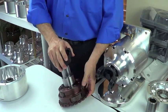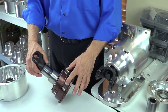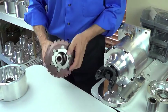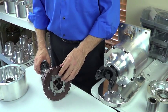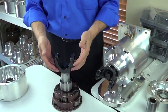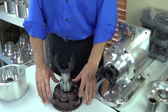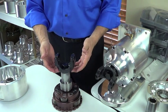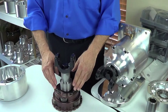The planetary gear set itself is a billet housing with 9310 gears. There are three tall pinion gears and three short pinion gears, and then all the way in the back in the center is the reaction sun gear. On this particular planetary system, the output shaft and its flange — what they call a nail — is one forging, bolted to the carrier. That's really important: if you were to damage a carrier or output shaft, you can simply unbolt and replace the damaged part.